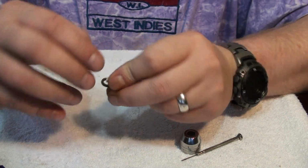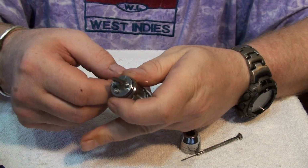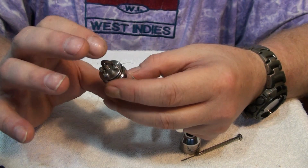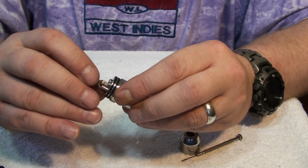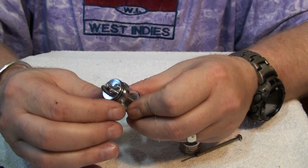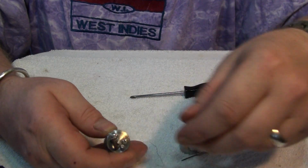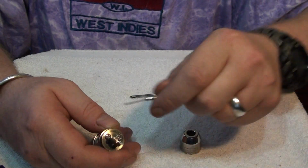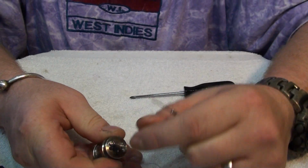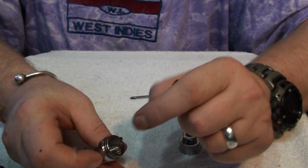Looks a little bit better this time. So I've grabbed a hold, now it's moved up out of the tank. There's a wick. We don't want it touching the centre post. Just going to lock that screw off a little bit tighter. Just space it away ever so slightly.